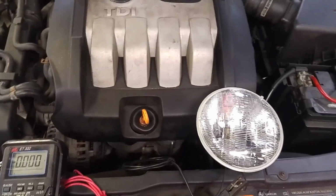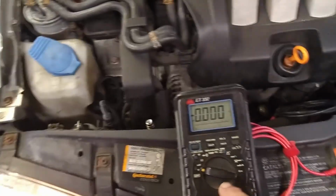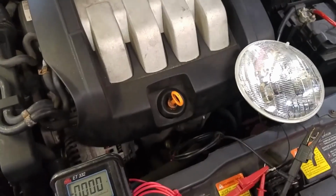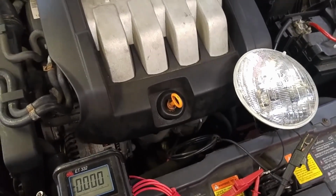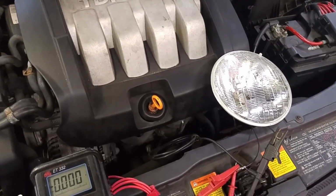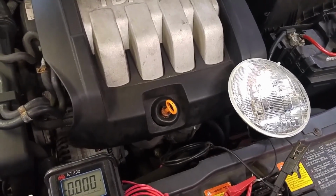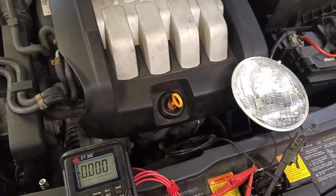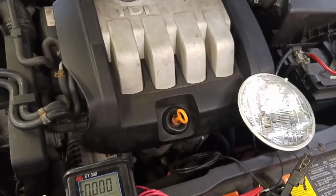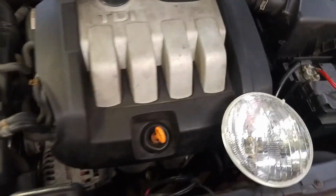It didn't see it. And what really got me was when I measured it on the voltmeter, I was seeing 12.2 volts, even with the engine running. So it's sending out a bias voltage, in a sense. It's sending out a signal but not applying enough voltage to operate the compressor, because it doesn't see the proper response back from the clutch in the way of resistance value. So gee, I've got to put some sort of load in there.